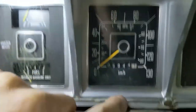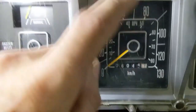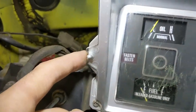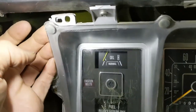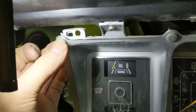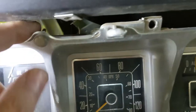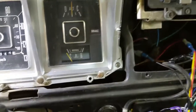When the dash is all back on and the lens is back in — remember it's concave so it goes inward. There are indexing slots and an indexing pin, so it can only go one way. When pushing the push pins back in, they take a bit of pressure. You might want to get it in place and hold the plastic piece from the back and push with your thumb, because you don't want to break the plastic housing or snap the tabs off. Brace the plastic really well — that's not an issue if you have the dash out because you can hold the back side.